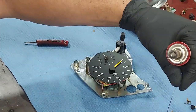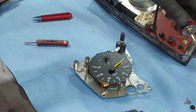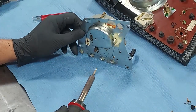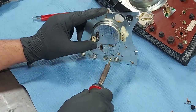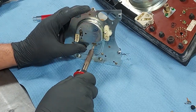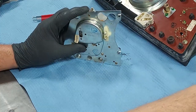And we want to go ahead and tin the tip. There we go. All right, we tilt that up. Now I'm going to put one hand right here on the power plug, and then we're going to melt the solder. There we go. See how it just popped loose?